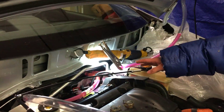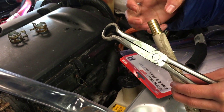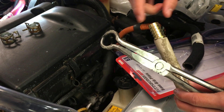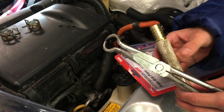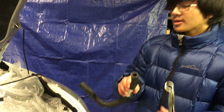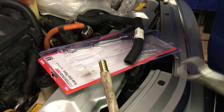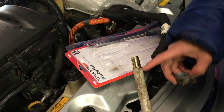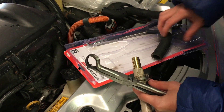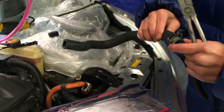It's not actually easy to put the clear hose on either, because first off, it's a bit hard to navigate in the back, and second off, the neck actually has an enlarged opening — at the stump it would be larger, but at the back it would be thinner so the clamp would secure it. After putting the hoses back in, what you want to do is put the clamps on first. So pretend this is a neck: put the clamp in first, then hook up the hose, then put the clamp onto the hose. If you put the clamp on the hose first and then try to put it in, it's going to be harder to get past that enlarged stump.